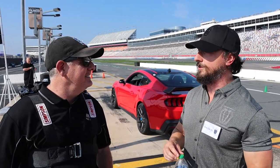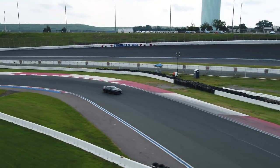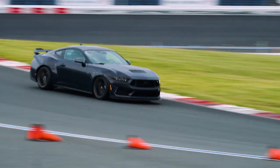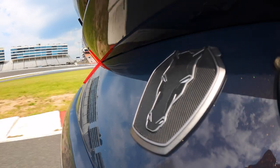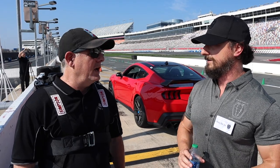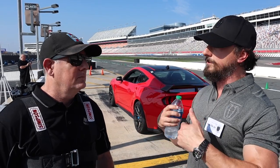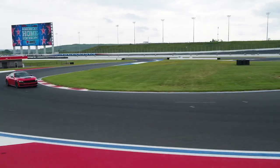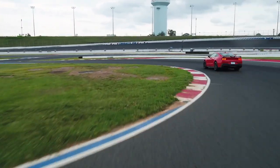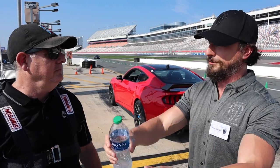I'm looking forward to getting your impression on the 10R too. We spent a lot of time in the auto-trans track mode making it as fun out here as the manual. It's a different experience — it's just as fast, and we actually leave it in D; we don't even touch the paddles when we're out here. The computer seems to do it better no matter what we're driving. We're looking at braking deceleration, steering wheel angle, and lateral acceleration to determine when to shift and when not to upset the car. The transmission is on the CAN network, so it's looking at how hard you're braking and how hard you're turning to determine when to do the downshifts. In a heavy braking zone it'll bang off some downshifts, but as you're trailing off the brake and starting to turn in, it holds the gear so it doesn't upset the car — you don't want it downshifting and losing the front end from a downshift into the torque band.